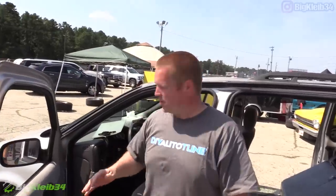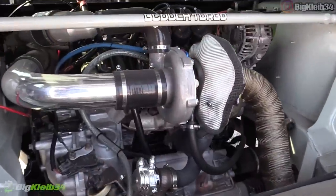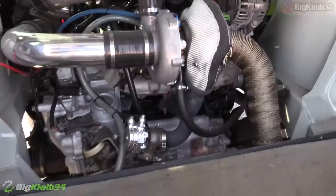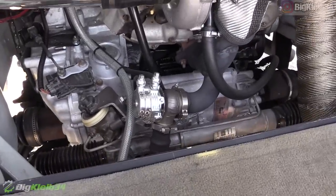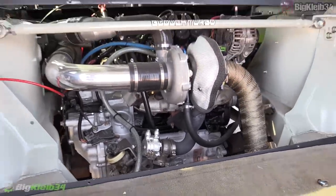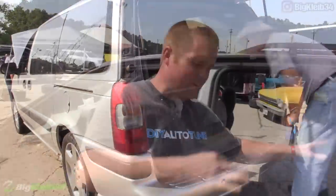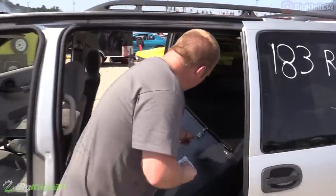Tell us what's going on. I don't even know where to start — give us the rundown. Well, it's actually two Chevy Ventures. You've got the stock 3400 V6 in the front with the low-mount turbo down under the seats here, and then I've got another van that I cut off right here at the firewall, basically at the doors, and welded the whole subframe — the front part of the strut towers and everything in the back here. So it has another stock 3400 V6, but it's turbocharged.